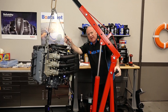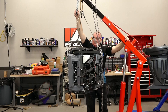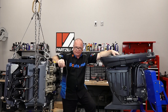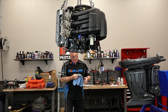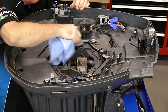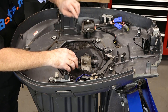She's free. Gonna pull it back, take off the engine mount, and then we'll connect it over to the chain hoist. This really isn't that tough to do. All we have to do is just lift it up a little bit more, get our gasket in place, set it down, make sure your dowels are in there, and then just bolt it back and get them torqued. One last cleaning at the bottom of this surface because we want to make sure that it has a good seal with the midsection. Same thing for the midsection surface — make sure it's cleaned up. Got our dowels in. Let's do this.